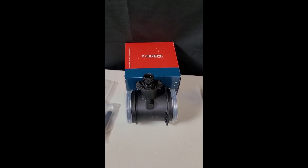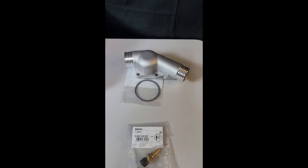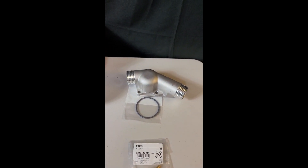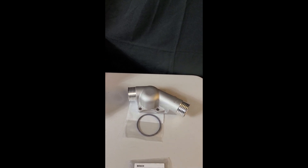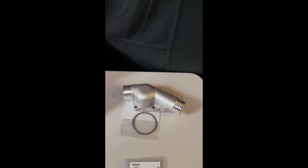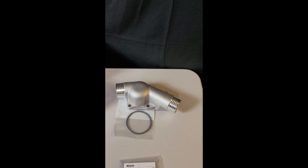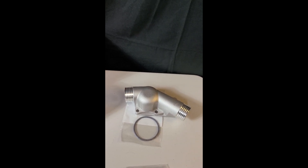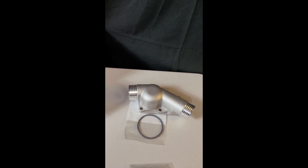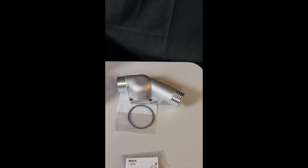I ordered a lot of Mishimoto silicone parts. You'll need an up-step from 3.5 down to 3 inches to get this installed — all that will come in the next video. I also have an aluminum thermostat housing here. These are really cheap — not more than $20. They replace the plastic one that you have. I already replaced it with a lower temperature thermostat, so I might as well swap the housing too. I have a race Mishimoto low-temperature thermostat currently, and I'll recycle that into this aluminum housing since it probably has less than 100 miles on it.